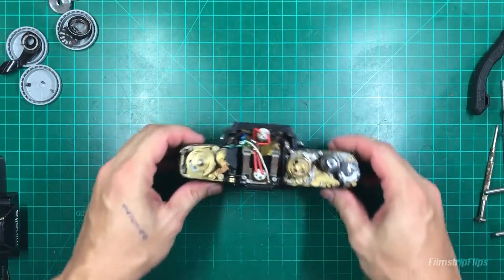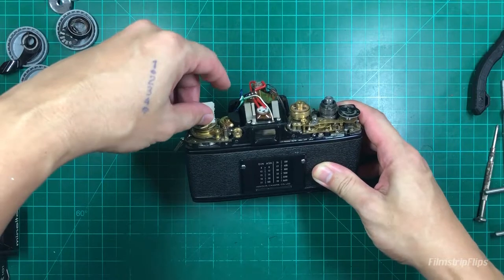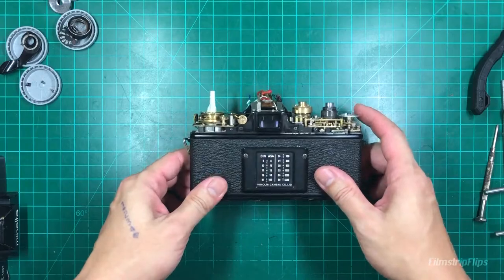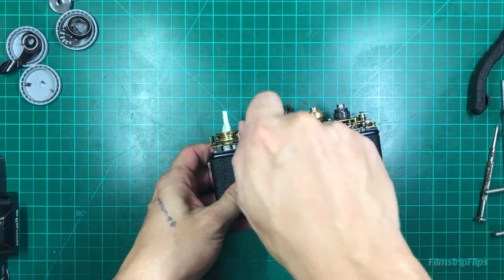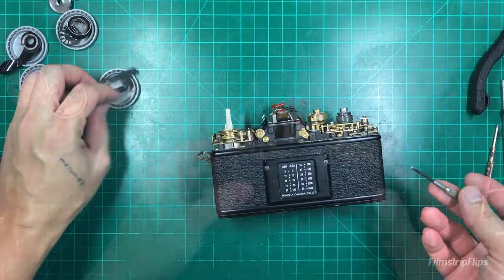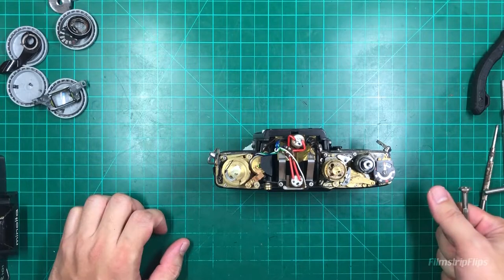Nice - that's real brass. What I do after that is I put tape here so that it doesn't come out accidentally. Now we are going to take out the screws for the viewfinder and simply lift this up so we can clean that later. Next thing is to take out the retainer for the prism so that we can gain access to the focus screen.